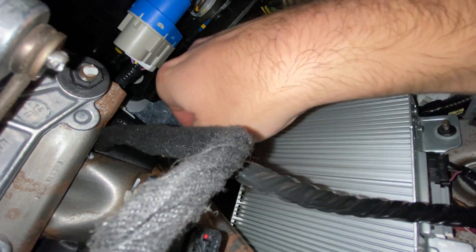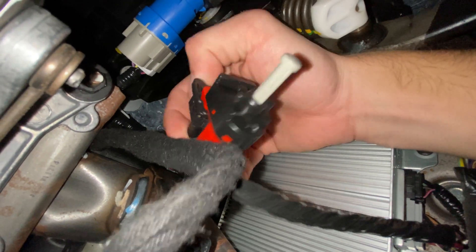The clutch will need to be tapped at pin 1. The best way to do this is to quarter-turn the whole housing, pull it out of its mounting bracket, and it'll bring it nice and low to make tapping way easier.